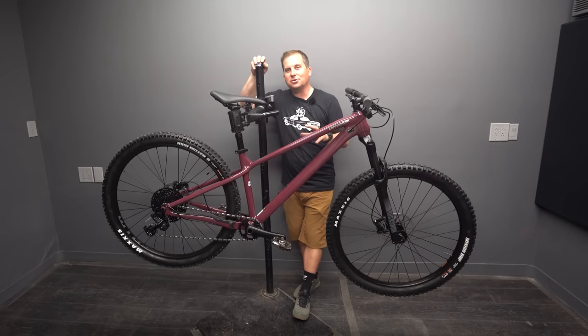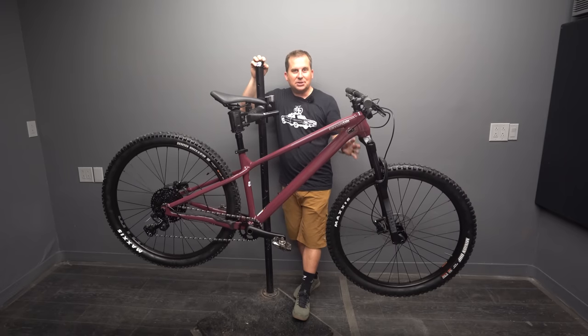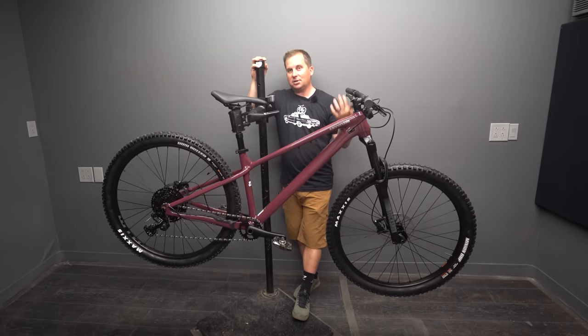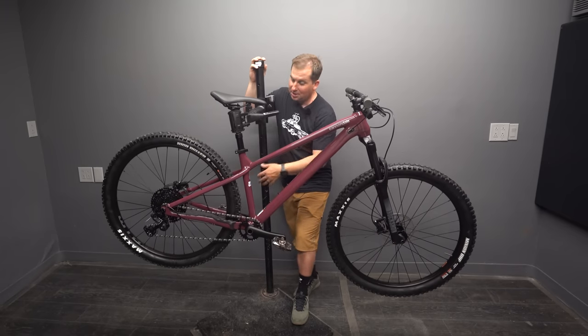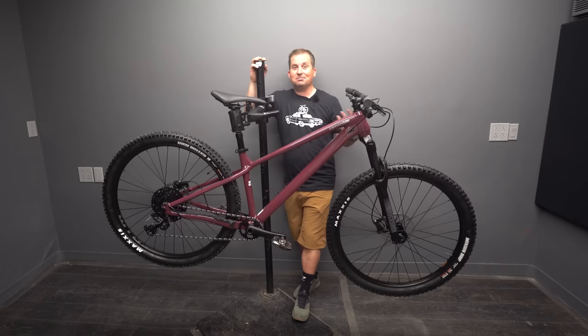This bike represents so many great things coming to hardtails. It kind of shows us the temperature of the market. They're not steep, sketchy XC bikes anymore. They're meant to be trail bikes that you can just take anywhere and ride all over the place. So we're seeing a SRAM UDH. If you wanted to put transmission on this, knock yourself out.